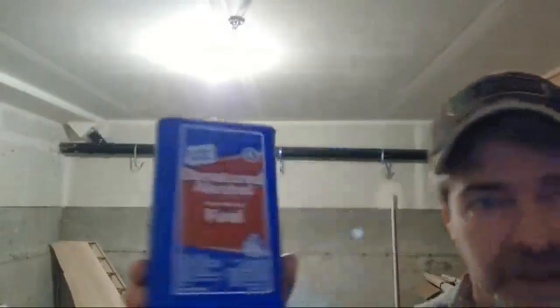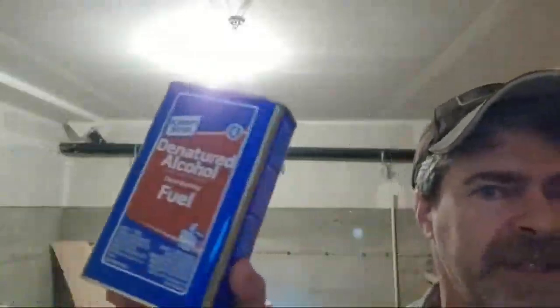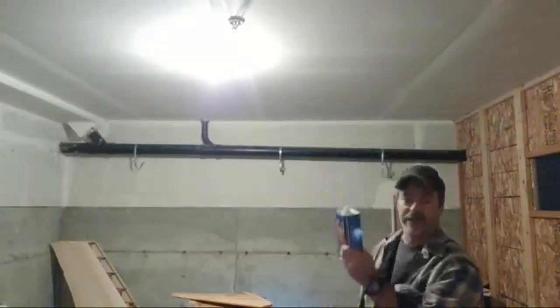this. And by the way, guys, when you're building, you're going to go through about 2 or 3 of these. This is denatured alcohol, any kind of work. Basically this is your cleaner. It will take any impurities out of that, it'll take the haze off, everything else you're doing. Don't use wax and grease removers. Use this stuff. This is what you tack it out with. This will clean that airplane.